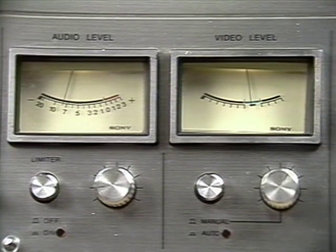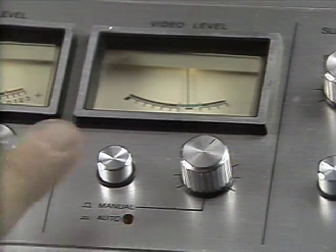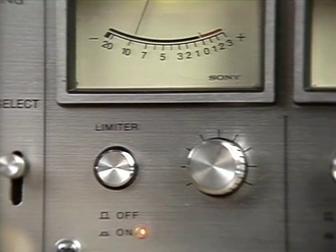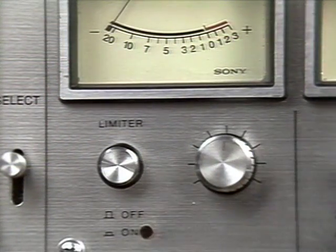The video and audio level knobs, which adjust how much picture and sound get recorded on your tape, do have to be set. Setting them too low will get you flat pictures and unintelligible sound. Setting them too high will get you distortion. Setting them drastically differently between your shots will cause annoying shifts noticeable between the pictures and sound. Generally, we prefer to operate the video level in the automatic mode. The audio knob gives you some choices — if it's labeled limiter, you might consider using it because it will help reduce unwanted peaks. But if that knob is labeled AGC, you probably shouldn't use it because it will amplify all the noise between words and sentences, and that can get awfully annoying. We prefer carefully adjusting the sound levels manually from shot to shot.